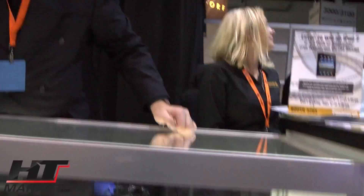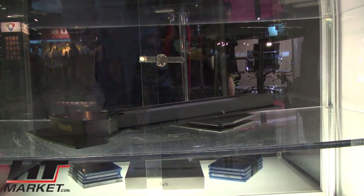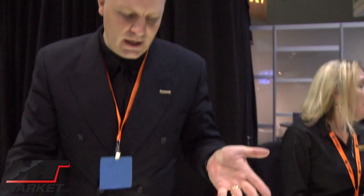Typically, yes, the RPA mount. As far as new products, the newest thing we have is the mount here in the center — we'll call it the Pana mount. The idea is to be a little more universal; you don't have to replace a plate when you replace your projector. It's a similar concept to the attachment plate — that's sort of the platform that the projector and the lens assembly hang from, and that mounts to the ceiling. It'll be pre-configured for major projector brands.